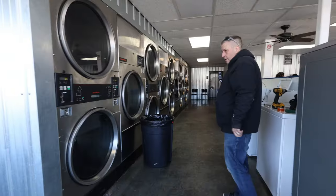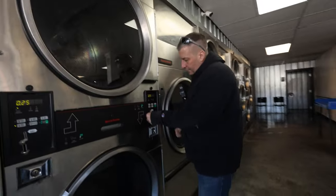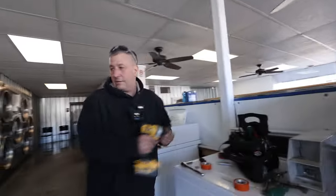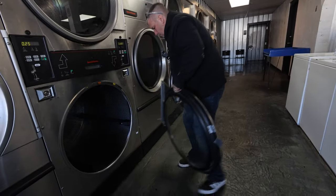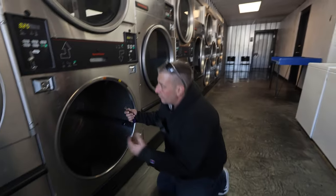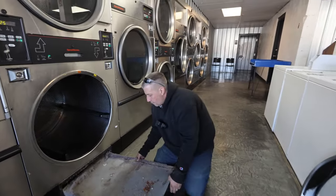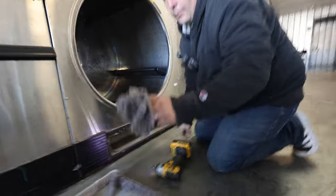All right, I'm going to clean it up real quick. This one I know has a problem — we're going to listen to it real quick. Might as well fix two dryers while we're here. Yep, it's got a problem. So let's pull it apart the same way. I think it's another roller bearing. What you're hearing is the drum riding around the inside edge of the door because it's not pushed up or down. The most common problem is a lot of heat gets around these bearings, wears them out — they kind of grenade on their own. That one just grenaded.